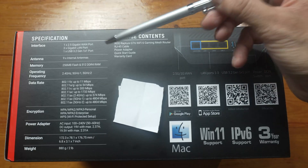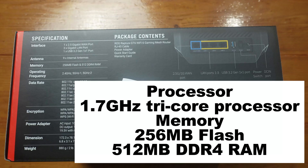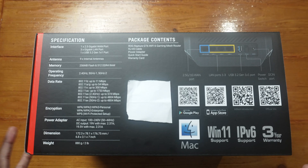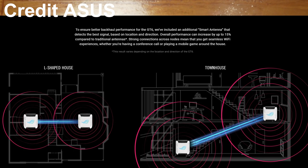We have some information on this side about what's included inside the box — nine antennas as I mentioned. If I were going to use another one of these, I will be using wireless backhaul, as I don't have cables running through my house to use Ethernet backhaul. So then I'll only have one 2.4 gigahertz band and one 5 gigahertz band. But as I'm using this alone, I could use the other 5 gigahertz band as well.